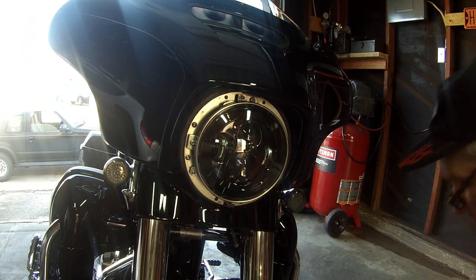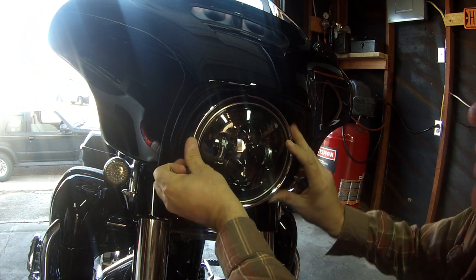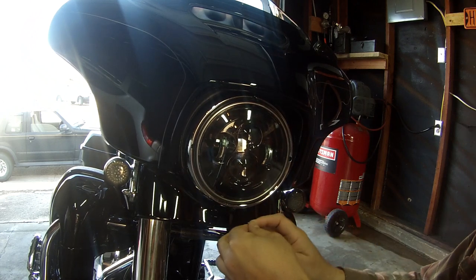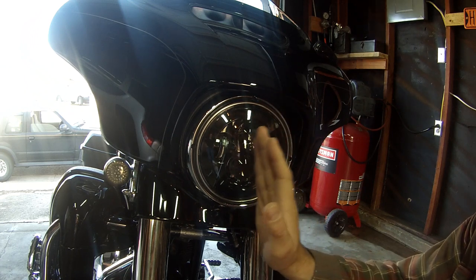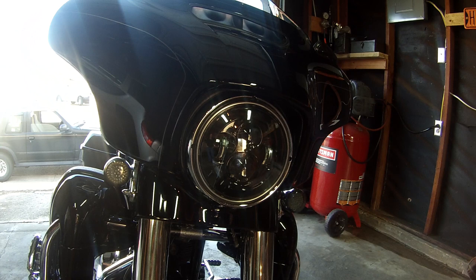To finalize the adjustment, put your headlight door back on and put your screw in and that'll be it. The hard part is really not the height — the hard part is lining the headlight up straight with the bike and getting it on the center point of that cross on the wall, because that affects whether the light shines too far left or right. But once you figure out those parameters, it's really easy: just three screws that you turn either clockwise or counterclockwise to get that headlight to the right angle. Ride strong, wrench proud, and be sure to visit rideatwrenchit.com and subscribe to the Ride and Wrench It channel.